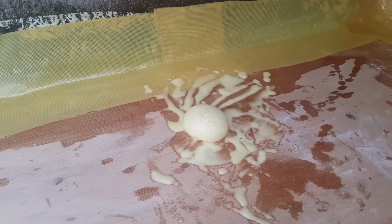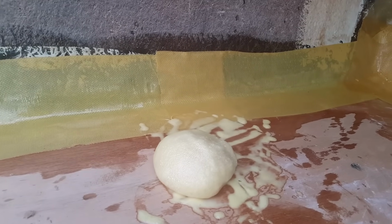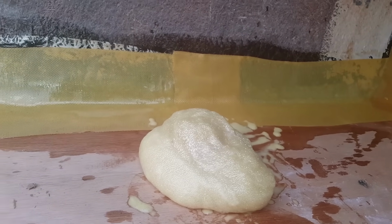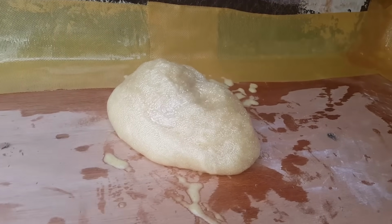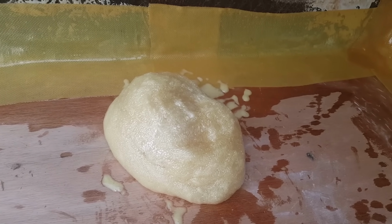All right, so you can see here it is starting to come out the top a little bit, and you may be tempted to put your foot on top of it, but definitely don't do that because it could cause some cracking and things underneath the floor if it has nowhere to expand to. So definitely let that foam come on out, and it'll be easy to come out, and you can use a saw blade or hacksaw blade afterwards to snip off the top.